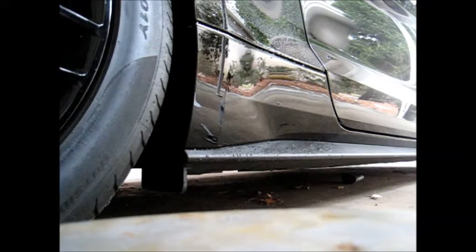With most of our other templates, if you're familiar with our product — especially the tint templates — we purposely overcut them slightly, between a sixteenth and a thirty-second, sometimes even a sixty-fourth depending on the piece, to make sure they taper properly. With the paint protection material, we do just the opposite, because you don't want it to wrap around corners.